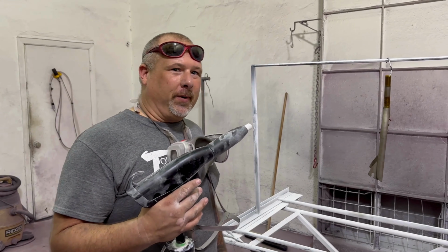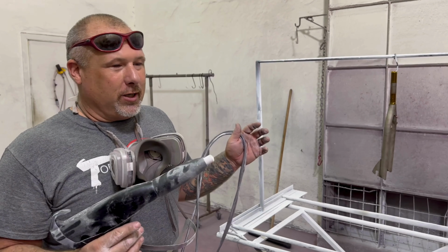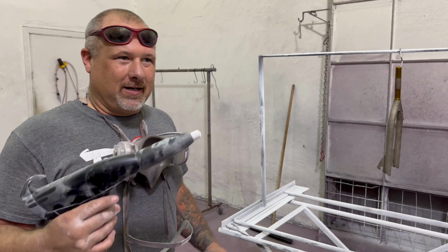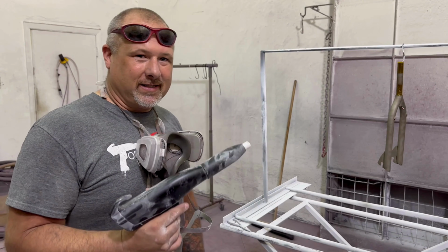So we're putting this Super Mirror White from Columbia Coatings on this frame and fork set first, because for any good day glow color, you got to use a white base, then the color, and then a clear on top of it. So it's actually a 3-stage process. So we're getting started off with a good base, and we'll go from there.